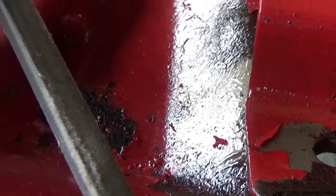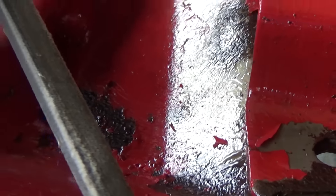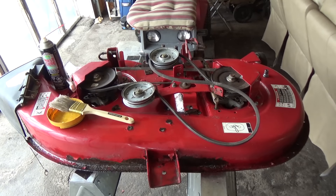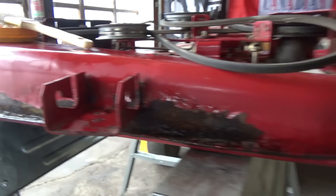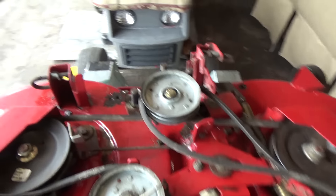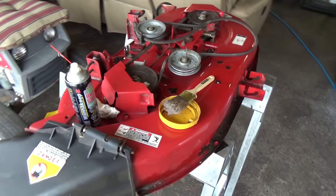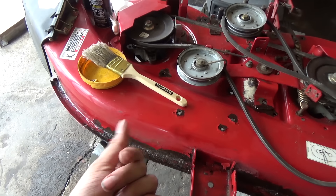It's not as good as paint, obviously. But the thing is, your paint is going to strip off eventually. And as long as you undercoat your deck or use rust preventative on it, you should never have to worry about your deck rotting through. Where the paint is starting to come off, you'll never have to worry about this section rotting out or developing an actual hole because we're using this rust preventative. This is just a quick little video explaining how we do it. Now, this stuff really doesn't dry — it's always going to have a little oily surface to it.